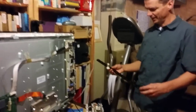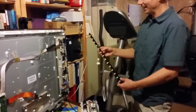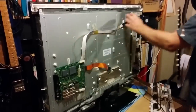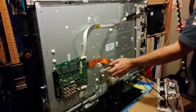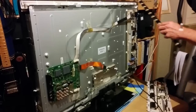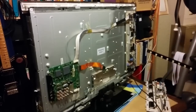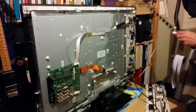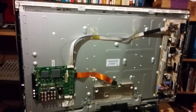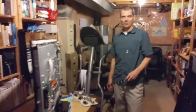I took the liberty, actually, of taking some of the components off of another TV, and I will get down to that level. The plan here is to essentially remove all of the critical boards very carefully, paying a lot of attention to these cables. There's a lot of conductors inside of them, so be very gentle with the disassembly. We'll go over those one board at a time, and then over a couple of days, we're going to actually disassemble and remove the entire LCD panel, carefully taking out all the layers. It's kind of a big job to get down to seeing and pulling out, if necessary, the actual CCFL bulbs. And we have a donor machine here. I'm hoping that they're the same specifications, they're the same width for sure. And maybe we'll have a working TV when we're done.